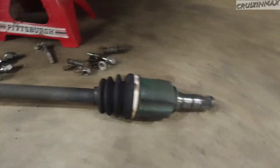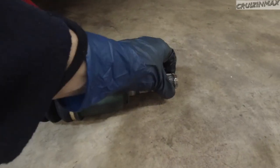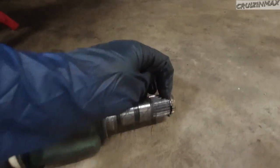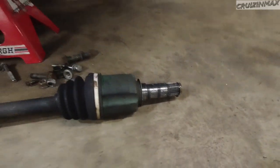We're ordering front axles for an older WRX because they supposedly come with removable stubs and ABS rings. On the 06, the stub is not removable — there's a pin that goes right through it. The WRX axles are the easy ones — you can just pry them out. On the 98 transmission there are likely inside C-clips, which is the issue.